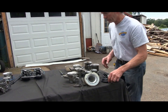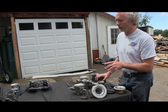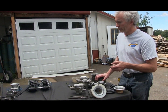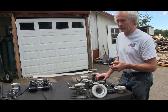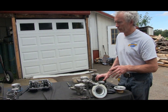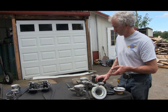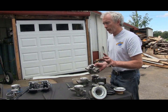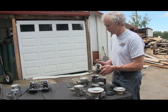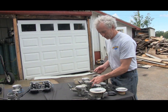One last thing to recap on everything: don't get caught up in a lot of hype — think about the basics. Boring your carbs on an XP-800 is going to give you 2 horsepower, which is a great gain. You're going to hear people saying you're getting 10 with a pipe and 6 with a Y-pipe — no, none of that's true. You'll gain 2 with a good Y-pipe, 3 with a pipe, 4½ in the upper mid-range. When you can gain 2 with the carbs, great gain — same on your big bore. If you can take a 5-horse big bore and add another 2 horse, that's a very good gain and you're not losing. The correct carb and the correct jetting for your application is the key. Hope this helps. Thanks.